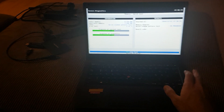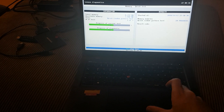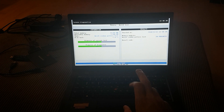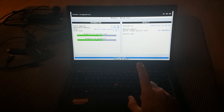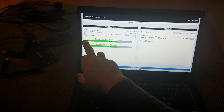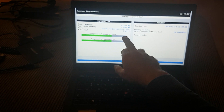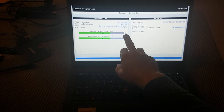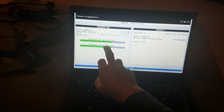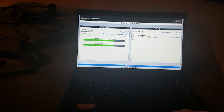All those symptoms have the same cause. First, if you are able to run the Lenovo Diagnostics tool and check if the RAM is in good condition — if this test doesn't go all the way to 100% and show success, that means the RAM is the problem.